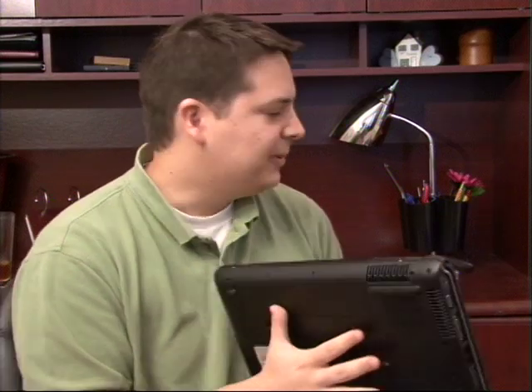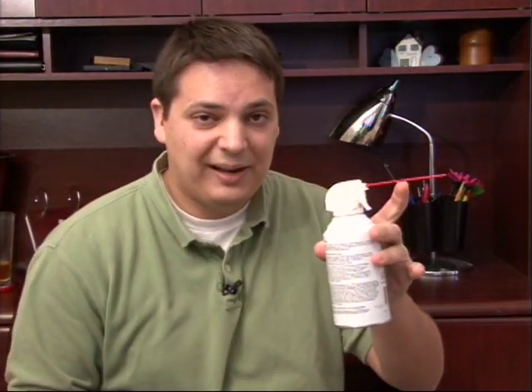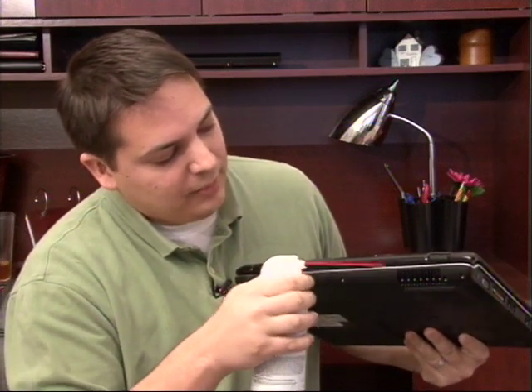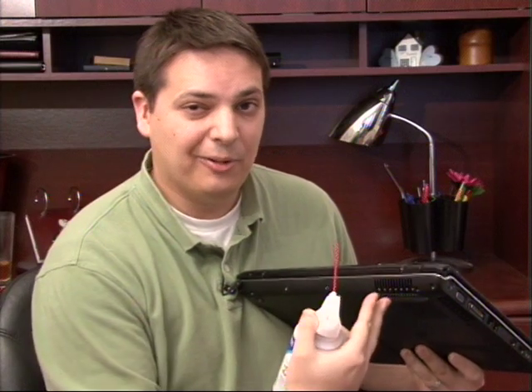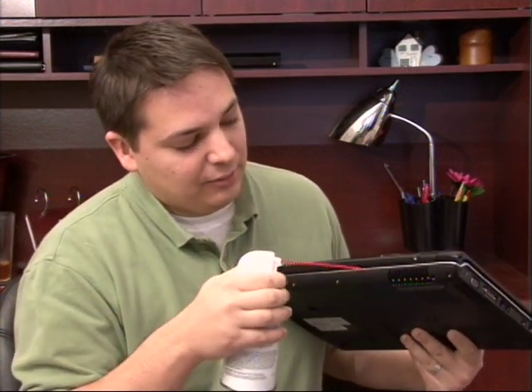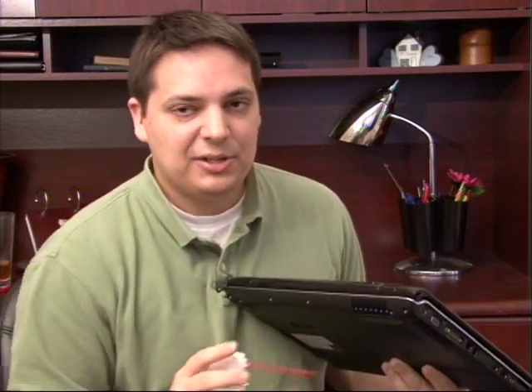Sometimes if your laptop is overheating, a good thing to do is take a tin of compressed air — you can get this at hardware stores or computer stores — and just real lightly blow in there a little bit. Don't do long spurts because that condenses and you'll actually be blowing water or liquid into there. So just do quick little bursts of air into your fan area to make sure any dust that's building up gets blown out and allows the air to escape.